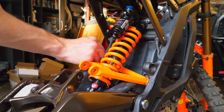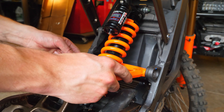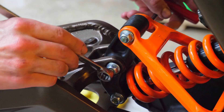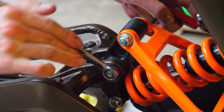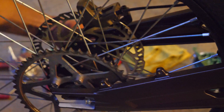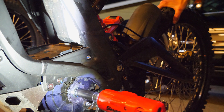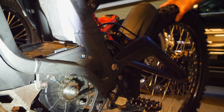I took apart my whole suspension linkage for powder coating, so the next thing you've got to do is just throw that back together — it's the reverse of removal. Just be sure to keep track of all the bushings, bearings, and bolts or else you're going to have a bad day. Once you have everything in, do one last tighten on everything and wipe it down. Last step is to throw the rear wheel back on. Once you have the wheel back on and can hold that shaft still, you're going to want to slam the nut back on with an impact and set up the proper tension on the motor.